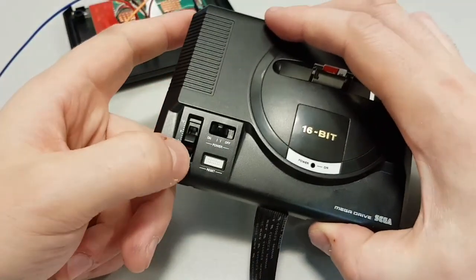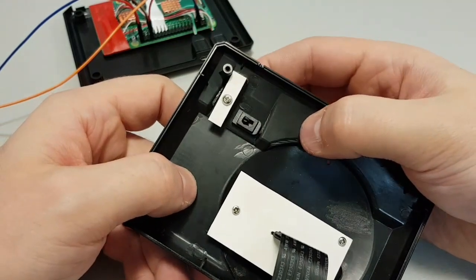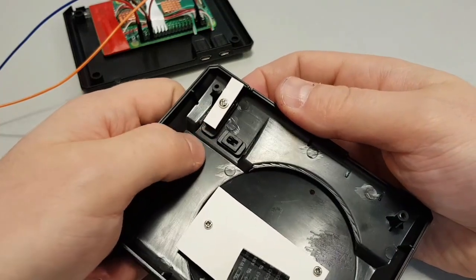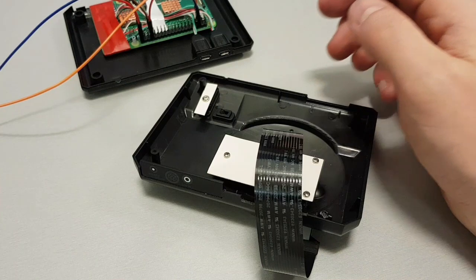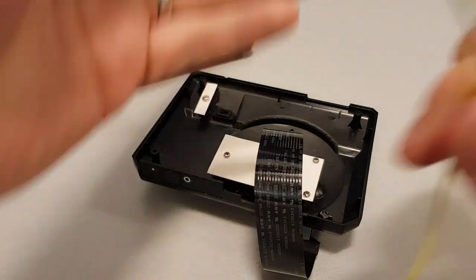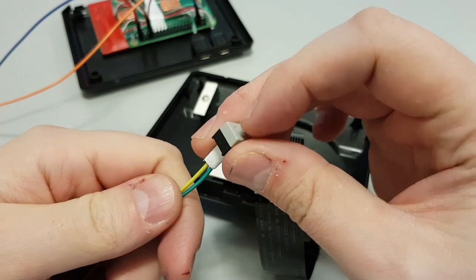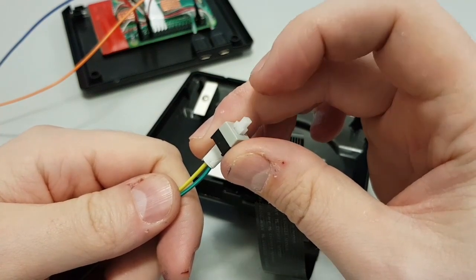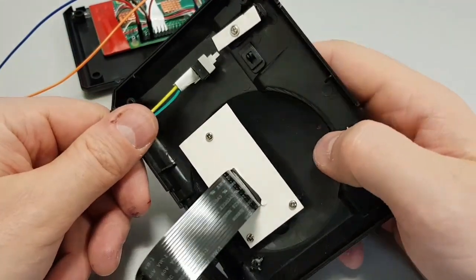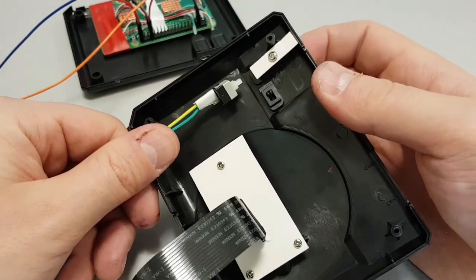And then this slider here, which used to be for the volume, what I thought I might do is if I add, say, a piece of plastic on there, I now have a really large sliding switch. So I thought at the back here, I might add, where did I leave it? It's over here. I might add this, which is just another on and off switch. So it's a two-stage switch. So you click on, that's on, that's off, on, off, on, off. And if I mount that back there, with that sliding in and out, it will slide on, click on, and then click off.